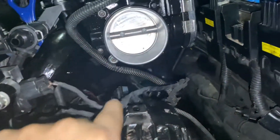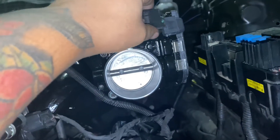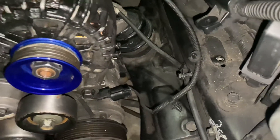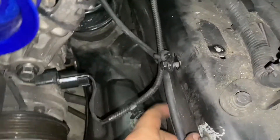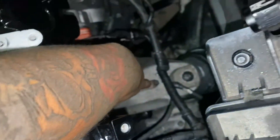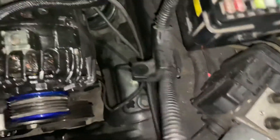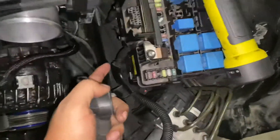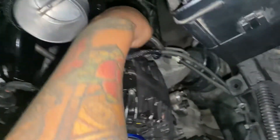I'm going to redo the harness for these two — zip tie everything and make it look nice. After cleaning up the harness, the ground strap goes right here onto the motor mount — there's a 10 millimeter right there. After the ground strap, this wire goes to your fuse box, and this cable goes to the back of the alternator where that nut is — I believe that's a 13 or 14 millimeter. The power cable for the alternator is on — that was a 12 millimeter — and the ground strap is on — that's a 10 millimeter.